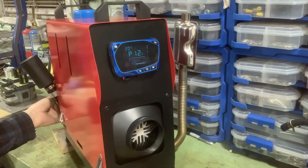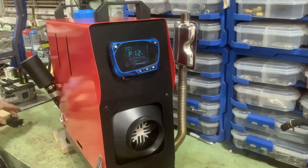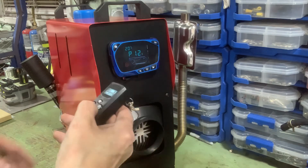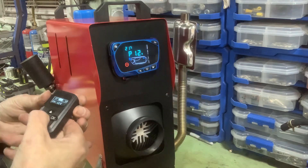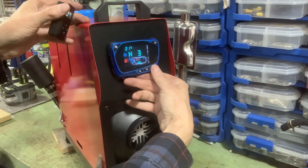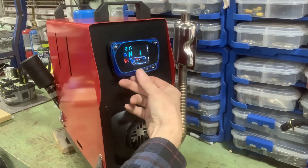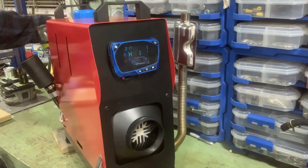Let's check the batteries, make sure we've got full power from both. We're on both batteries. We'll start the remote up — it's synchronized, 12 volts, 20 degrees Celsius. We're going to turn it on. Hold the power — there we go. We'll turn the heat level down. I want to start it on one. One of the weird things about this control panel — the arrow forward is actually down. You'd think that would be higher and that'd be low, but it's the opposite. She's running and blowing cool air.